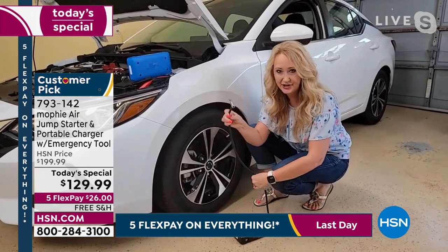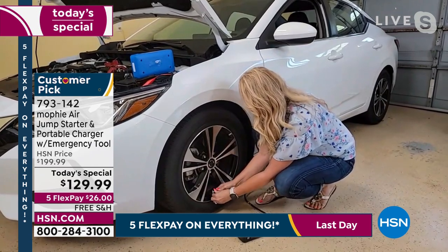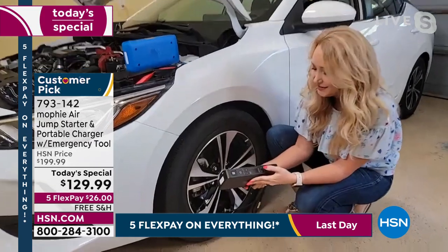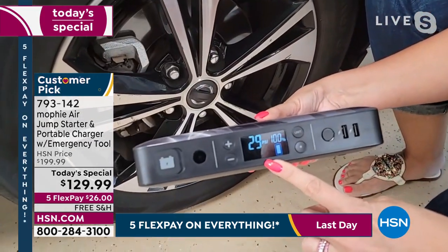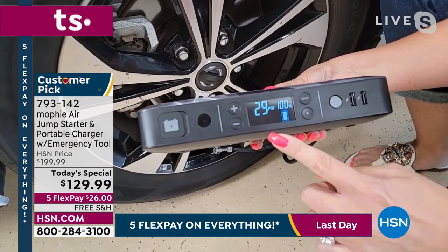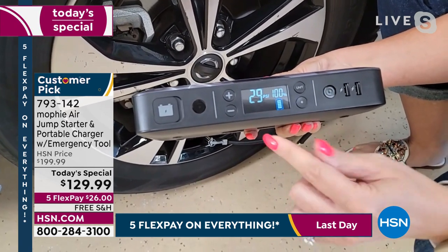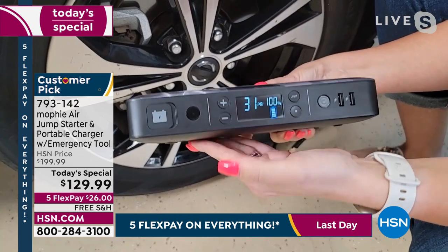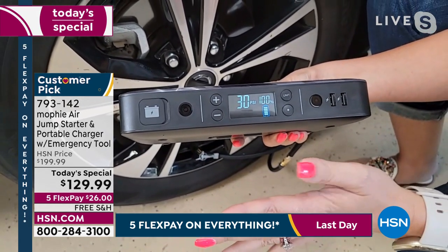So you're getting this great extender hose, and then that way you can just track down where you unscrew the little cap for your tire. I'm just going to secure it into place. Now, Tamara, I'm going to tap the unit button right here because this has a pressure gauge built right in. I can see that I'm at 29 PSI. If you open up your car door, you're going to be able to see how many PSIs it's supposed to be. This one's supposed to be at 33. So you can simply increase up to that number. I'm just going to go up a couple or just one here really quickly to show you.